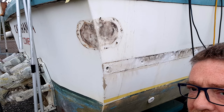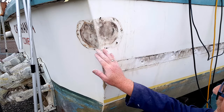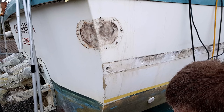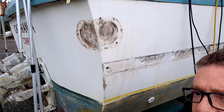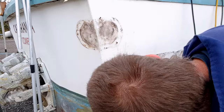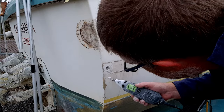We have a big hole in the transom and I'm wondering how far back I should take it to see what's actually going on. There's already been some repairs on here and we've got all this section to worry about as well. It sounds fine, so I'm hoping it's nothing too serious. I just hope — the idea that the transom would have to come out fills me with absolute abject terror, and I think if that was the case I would probably set fire to the boat. As far as I can see that's glass all the way through. If anybody knows if the transom is solid layup I'd very much appreciate knowing.